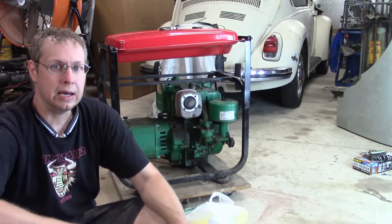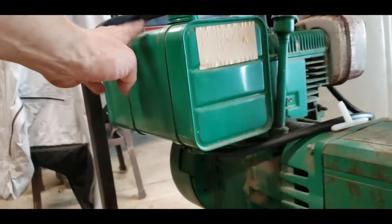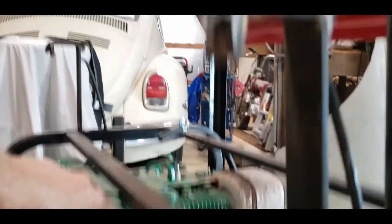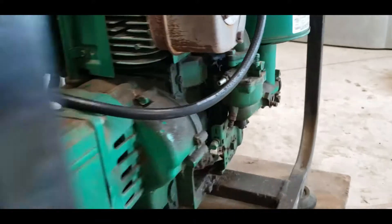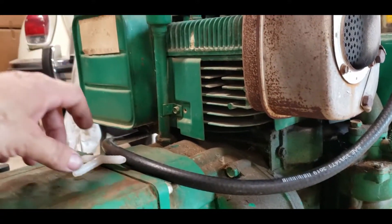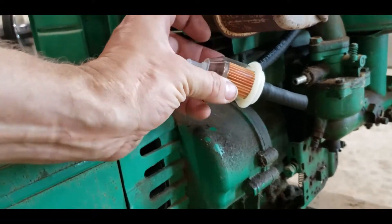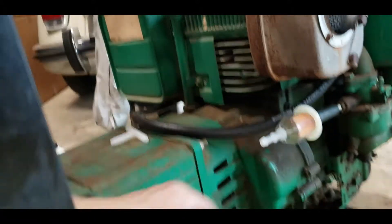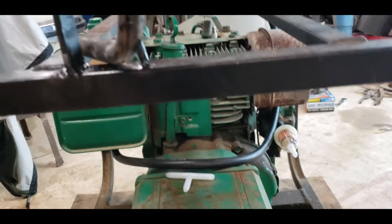The idea is pretty simple. We're going to tap into this petcock down here on the lower tank - the original tank - bring it around, put this T in about the middle right there. Fuel line will go up to the petcock on the upper tank, follow it right back down to the top of the T, bring it around, and fuel line will end up right there in the barb fitting of the carburetor. The fuel filter will go right here too, giving us a little extra length.